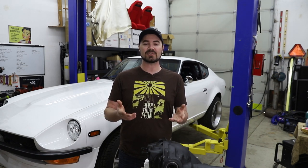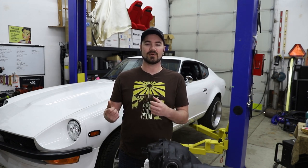They sourced a bunch of parts for this car and it seems like everything they did or sourced was a disaster. I undid most of the work they did, did it correctly, and fixed a lot of their issues. But once we got the car to a dyno, the engine exploded by spitting a rocker, which isn't terribly uncommon for SR20s, but is something they probably should have checked the tolerances of before they gave the car back to me. We hadn't really gone through it, so we were surprised.